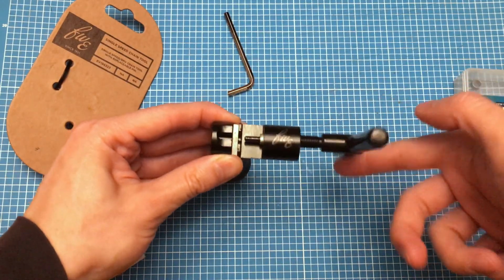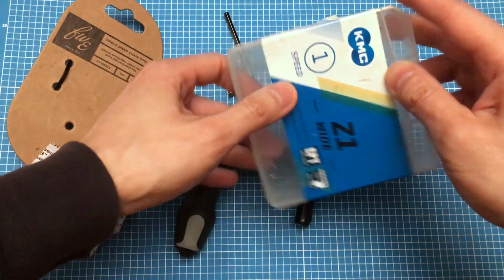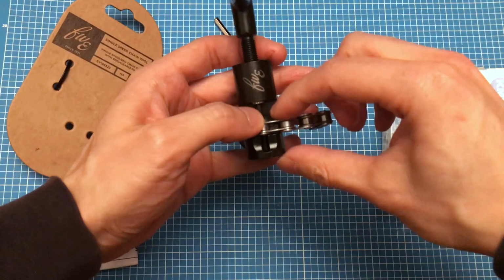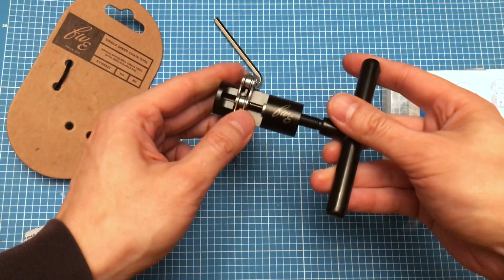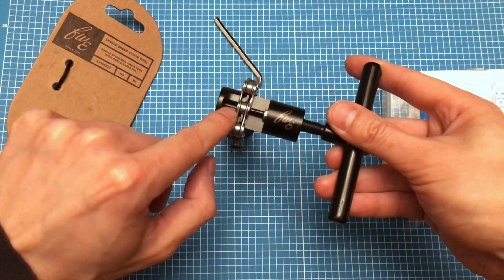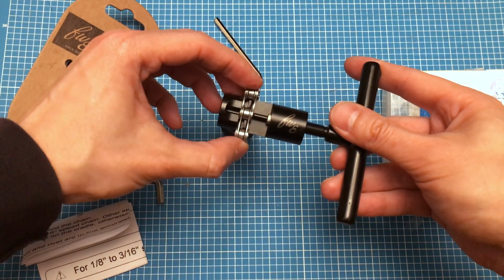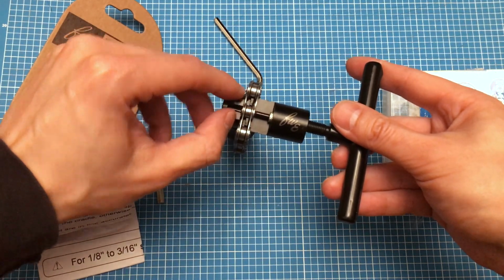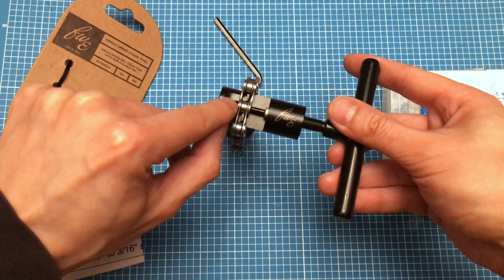So this one is designed for single speed chains, which are bigger. The multiple speed chains are thinner, more narrow. You see, the pin is going into that pin, pushing this against this main wall here. The cradle is really not a place to hold the chain in this direction. It's really just to set it in place. It's this main wall that is actually required to hold this whole chain for this pin to go through.